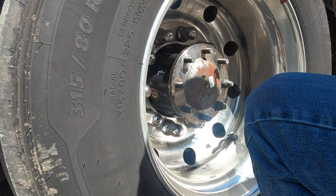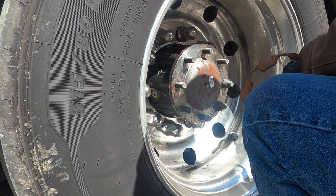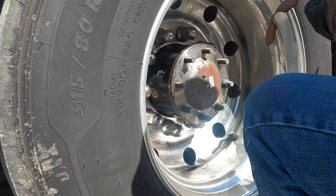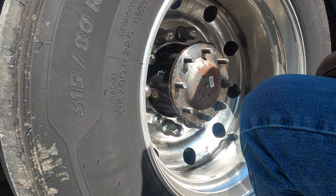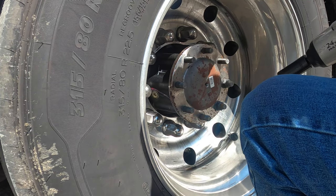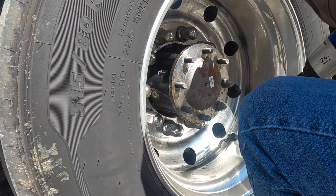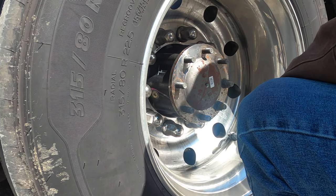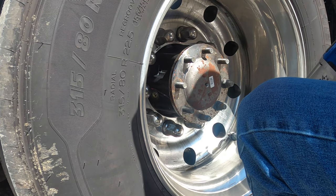They're going to put this piece of paper gasket back in. Now, this should hold up way better than this. But you do what you want. If you want them to put the paper gasket back in, have them do it, but I would definitely have them check the other side. I'm going to torque them, make sure they're tight after we get done with this one. And I would definitely have them check the oil, make sure you didn't lose too much oil.